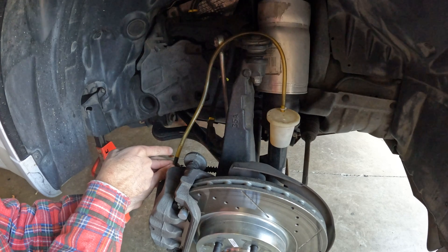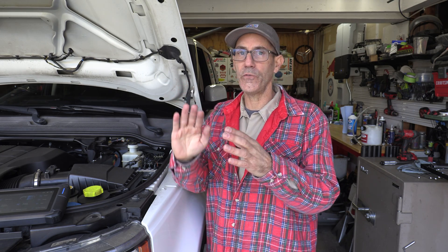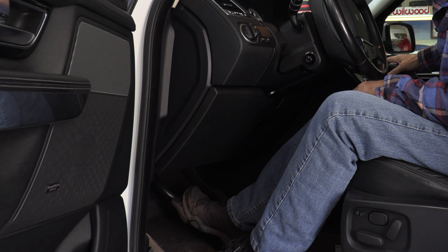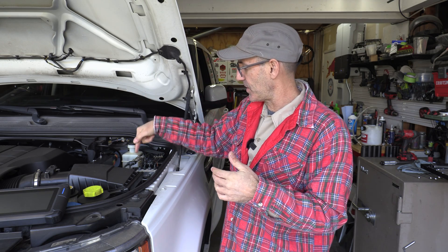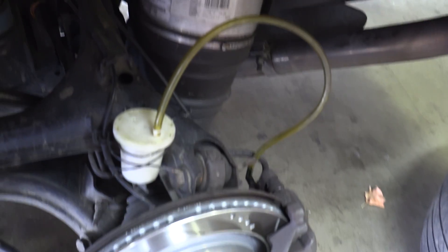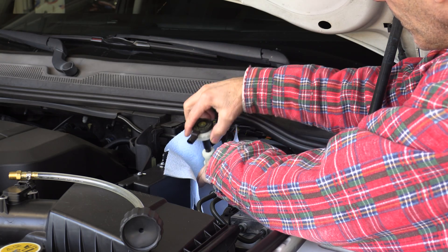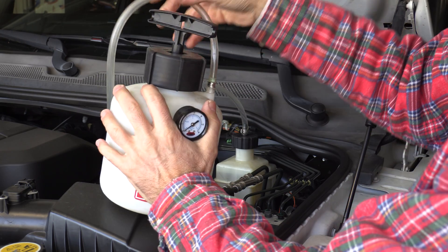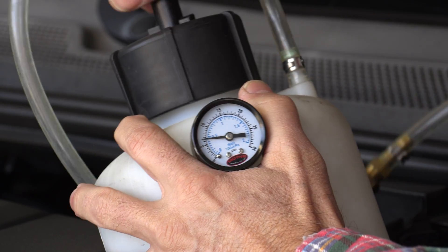That's what we're going to do today and see if we can improve the pedal feel. To reiterate, the brakes have been excellent — it's just that pedal feel down to the floor that doesn't feel confidence inspiring. So let's set up and get to the bleeding. Generally bleeding brakes is a two-person job, but with my Motive Power Bleeder I can get pretty decent results. This thing enables you to generate positive pressure inside the brake reservoir to take the place of somebody pumping the pedal.